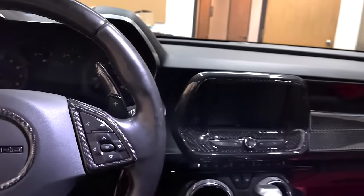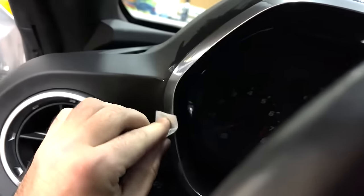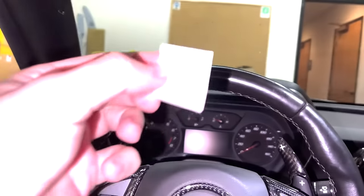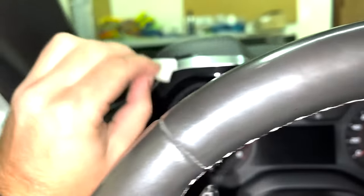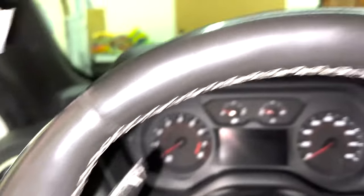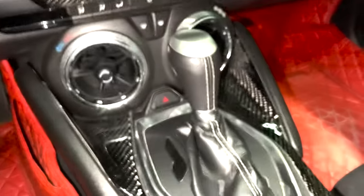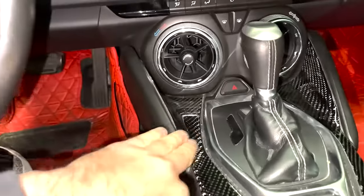We're not stopping here, guys. Just gonna prep the area real quick with the alcohol pads — make sure it's nice and clean, no residue, no oils — to get a nice surface for the piece to stick to. Here we have the adhesive promoter pad; just lightly brush this on to help the pieces adhere. This is not required for all parts, but it definitely helps, especially for interior parts like the center console overlay, where the promoter pads ensure it fits all the curves and stays down.